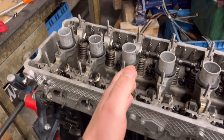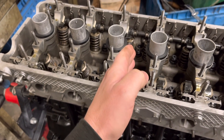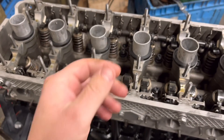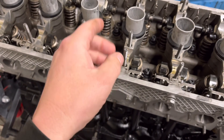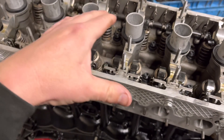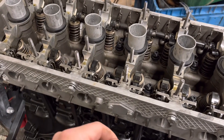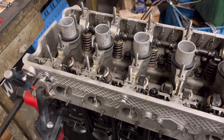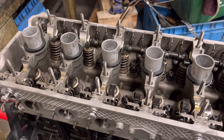I've done the first torque setting. When I always do the first torque setting — the 22.5 foot-pounds — as opposed to the angle, you go from the middle, whatever the sequence is. But I go through the sequence, then I go back and do it again, because what you find is the centre two will always go a little bit slack. I go through until they all torque down to what it states on the first stage, and then I do my 90-90.